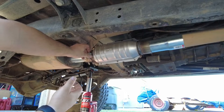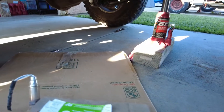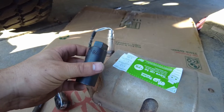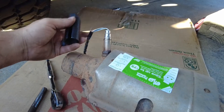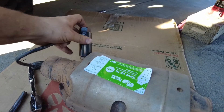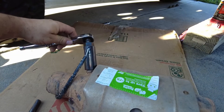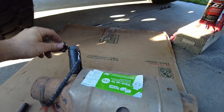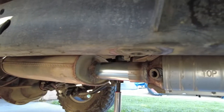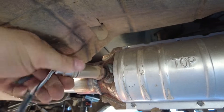I'm going to swap out the O2 sensor. You just remove this plug, then use a special socket — you can rent it from AutoZone, I ended up just buying this one. It's a 7/8 socket with a slot for the O2 sensor cabling, designed specifically to remove O2 sensors. It slips over just like that, then you use a socket wrench to loosen it. I've already cracked it loose, so I'll unthread it, clean it up, and swap it over to the hole on the new cat. I'll thread it in now before we start welding so I don't have to worry about it later.